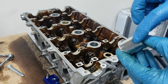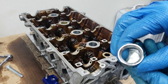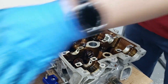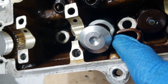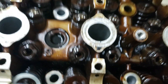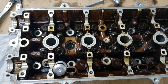One additional thing we had to do is grind down some of the edges on the valve spring compressor tool so that it fits the engine a little better. All I did was grind down this area here just a slight bit - not a lot, just a very little bit - and then it'll fit perfectly in these valves. The reason you have to grind it down is because this edge hits when it's fully round. It wasn't such a big deal on the intake side, but on the exhaust side because of this indent and these holes, that's why we have to grind it down a little bit. The tool still works - we're just going to use it like this after grinding.